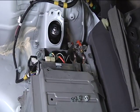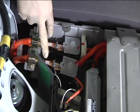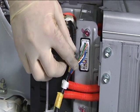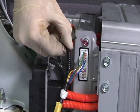I've just taken off the last battery cover from the Prius battery pack, and now we've exposed the high voltage terminals that we're going to hook up to. In just a second we're going to splice the A123 wiring harness into this plug, which is the battery computer, and also this plug right here.